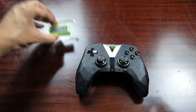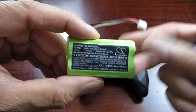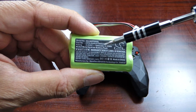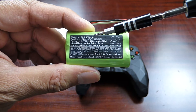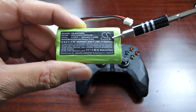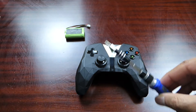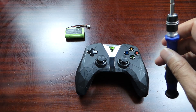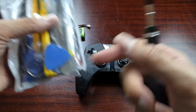What I'm going to do is put this replacement battery into the controller. The battery is 1,800 mAh and the part number is NSP920SL. I'm going to use a Torx 6 bit and possibly some mobile phone prying tools — I don't know if I'll need them but I have them just in case.